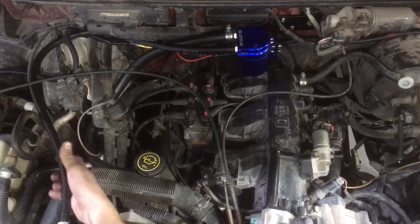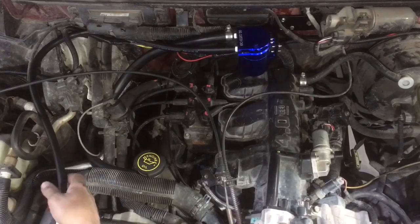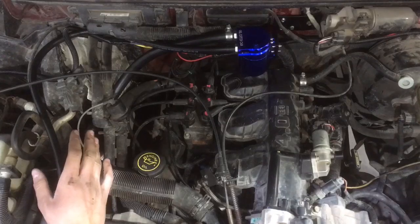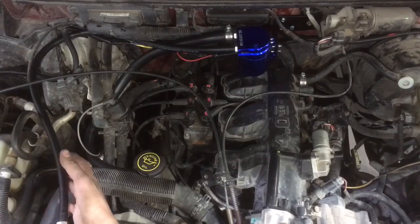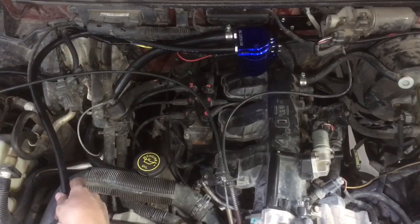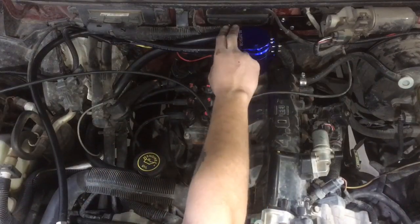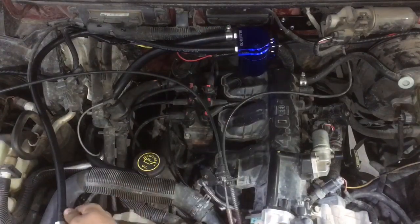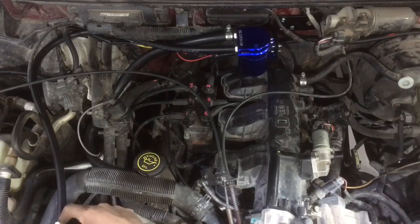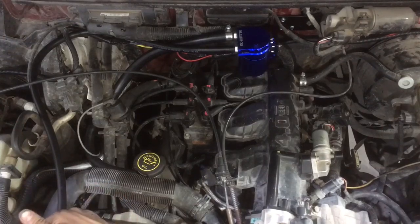The reason this hose is so long is that eventually this truck is going to have a custom intake done to it. I didn't want to cut this because this hydraulic hose is fairly expensive — about 3 feet of 3/8 and 3 feet of 5/8, and it was actually almost $25 for just 6 feet of hose. This will be shortened to the correct length once the intake is done. The catch can comes with four standard fittings: two 5/8 and two 3/8. I used two 3/8 for the outlet and only needed one 5/8 for the inlet. On this side I took the factory piece, cut a little bit off, put the fitting into it, and hose clamped the fitting in, so I can always pull this fitting back out and tap it into my new intake when I build it.